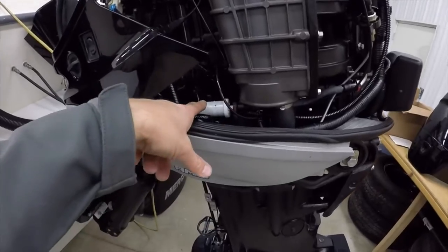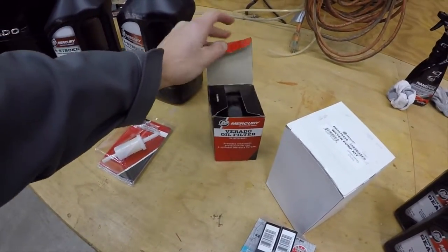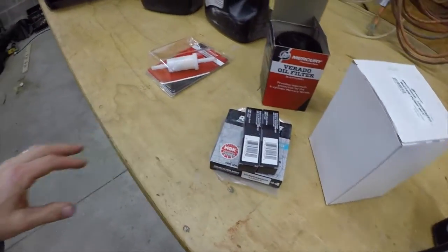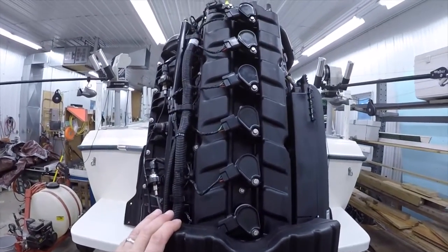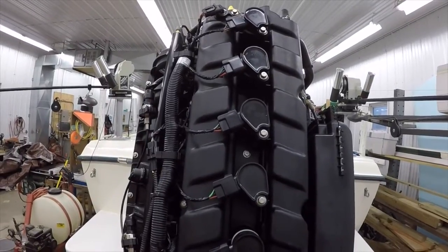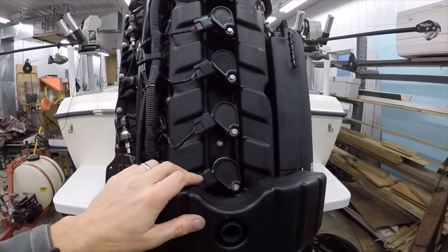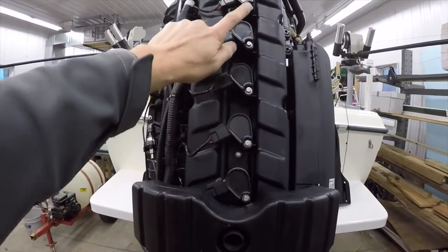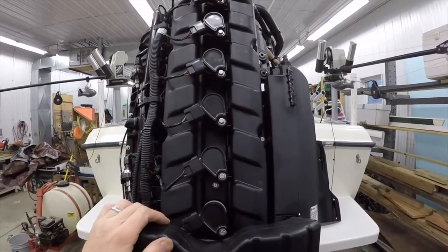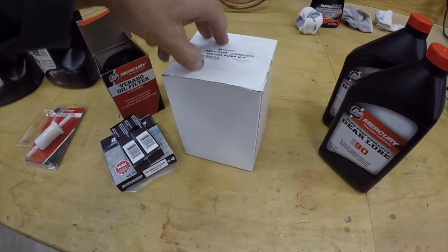So what are some things we're going to do? Well, this fuel filter here we're going to replace — I purchased the new inline fuel filter. I have a new Mercury Verado oil filter, so this is the engine oil filter. I'm going to replace the spark plugs, which are super easy to get at. For winter maintenance, you pull these coils off, pull the plugs out, and then I spray some fogging oil into each of the cylinders and cycle the key to distribute the oil, then put it all back together. Here are my new plugs.